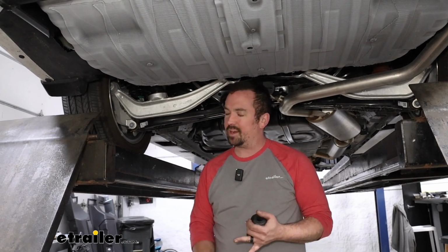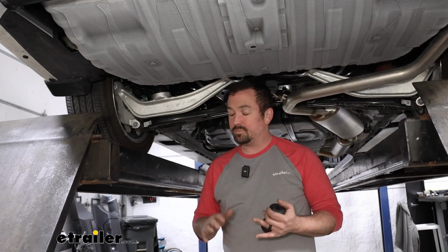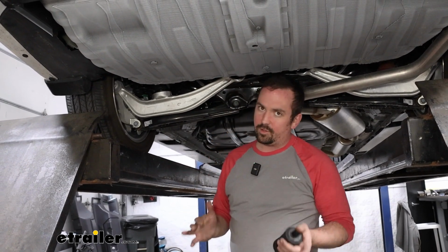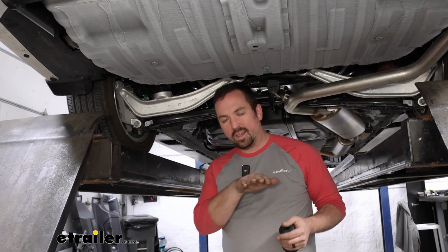And it's not just the vehicle sagging in the back that causes issues. Up front, you're going to notice that you have less steering feel, your braking's not going to be as good. Sometimes your headlight heights can pitch up depending on the weight. And also vans really do kind of have a sway to them.